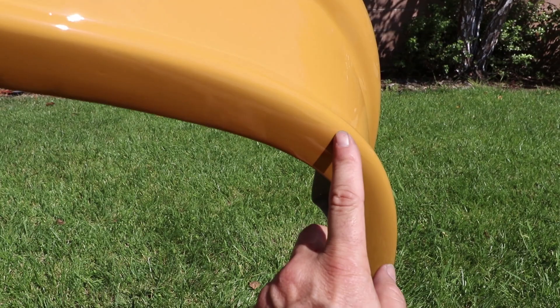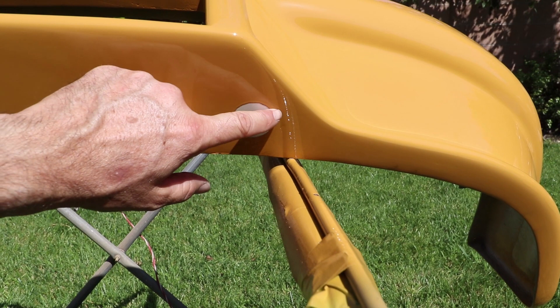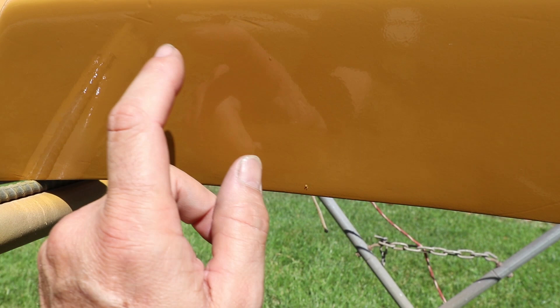This is the original paint — I cleared over that. The edge is not super great because there's a little bit of primer showing, but that's just to preserve the original color of this part. Down here I didn't do as much prep, and you can really see there's a scratch — the paint did not cover that scratch. I knew it was there but I didn't fix it because it's on the bottom. This is the kind of thing I was talking about in the prep: if you don't take care of it, it will show up in the paint.